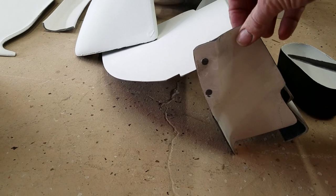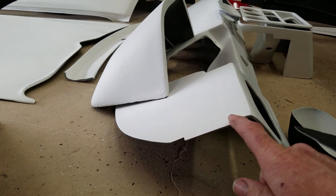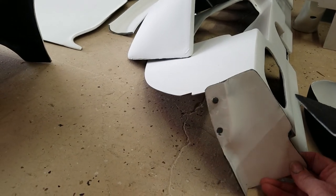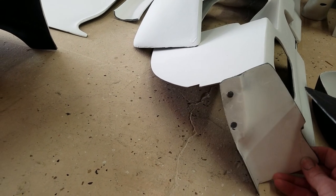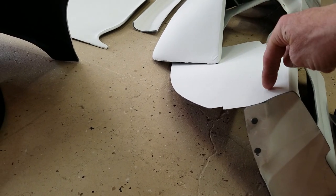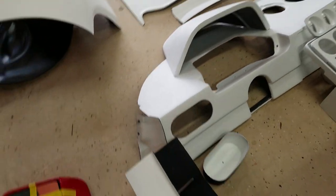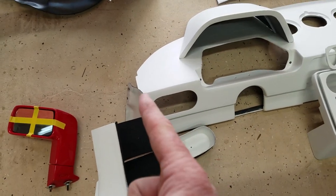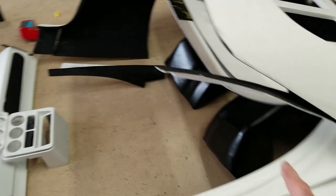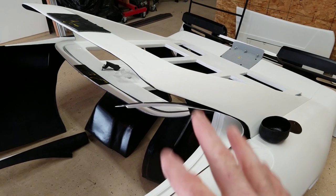There's a little better close-up of the dash. These are the side pieces — depending on your car and how your dash fits in there, you might want to trim some of this away. We left these separate so if you trim that away you can put that on to finish it off and fiberglass this to this so it becomes one piece, then cover it. You'll notice you'll have a little bit of gap in your dash right there that you get to play with for how you want it to fit in your car. There's the other vent — we do that separate because it seems a little bit easier.